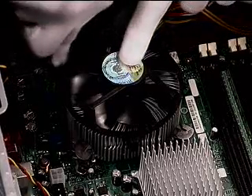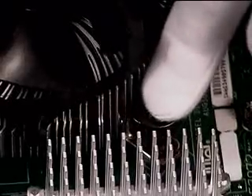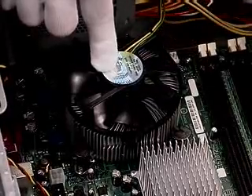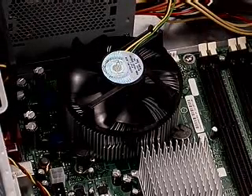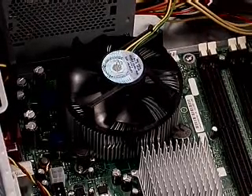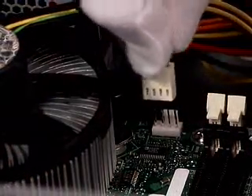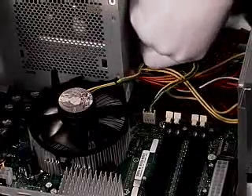To activate the four caps, press down on them with your fingertip while applying downward pressure on the heatsink to prevent it from tilting. You do not need to rotate the fasteners during installation. Check that both the fastener caps and the base are flush with the motherboard. Now connect the four-pin fan header with the motherboard header, noting proper key orientation. Finally, ensure that any excess cabling does not interfere with fan operation.